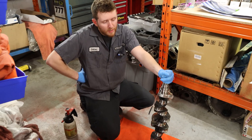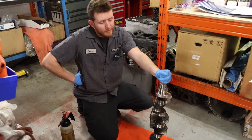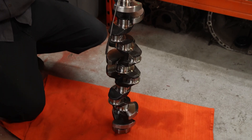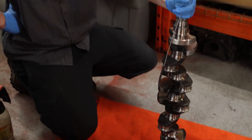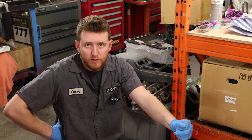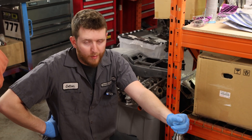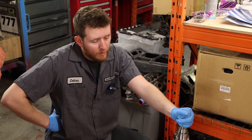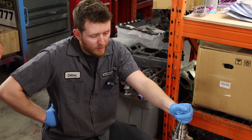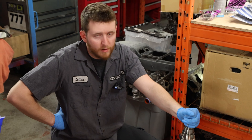We're just going to clean up this crankshaft in preparation for install. It's a brand new crankshaft from Nissan so it was not ground — it's not going to have excessive metal inside it. We're pretty much just going to clean up any assembly oil or dust or debris that might have gotten in during the balancing process. We're going to run the brushes through, run a little bit of brake cleaner on the outside, and finish up with isopropyl alcohol before we install it in the block.